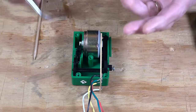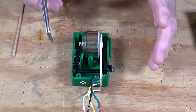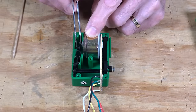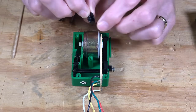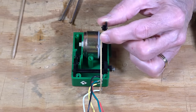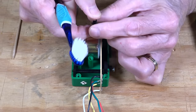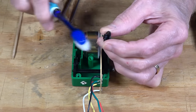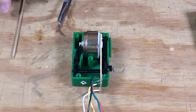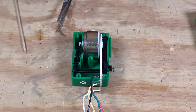If you've heard a clicking sound when these were in use, particles can get stuck in the gear teeth. Under magnification check these out and see if you've got any pieces of plastic wedged in there. You can run a brush over them to clean out any particles — that's why I use this fine toothbrush. Do that with all of the various gears. If you don't remember any clicking, you don't need to do every single one.